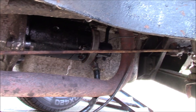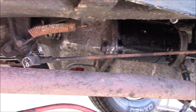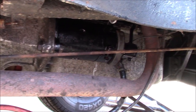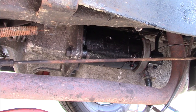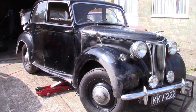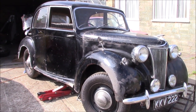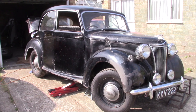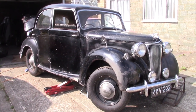We think one of the reasons the brakes have been quite so poor is not just the lack of adjustment but this brake rod - particularly when we first disconnected it - was quite stiff. So we're wondering if it's just lack of use, everything's just a bit stuck, because the brakes aren't dragging, they're just not engaging particularly well on the foot pedal. I did want to get a few more things done today but I'm out of time. You'll have to wait and see with this starter motor although I can't see it not working, to be honest. It did work before, just intermittently, so it now should be reliable.